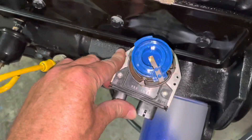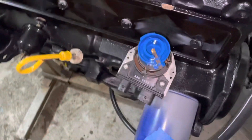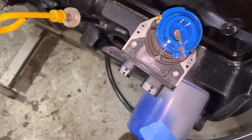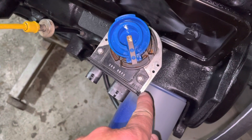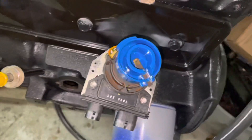That time the distributor did seat — it's seated against the engine block. If I rotate this distributor to where the rotor is pointing to that corner, that's about where I want it. It's not going to be perfectly straight out, but it's close enough. So this engine is now statically timed, meaning the engine's at top dead center, this rotor is pointing where the number one spark plug tower will be, and it's seated inside the engine. It's now statically timed.